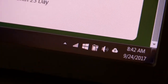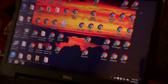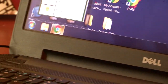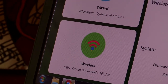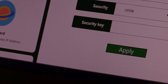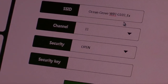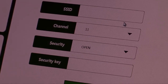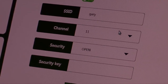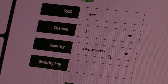Now if you want to have a password while you're in the campground, you can do this. Once you're connected to underscore EXT, you go back over to Google Chrome, open up Google Chrome and choose wireless at the bottom and select wireless. You see you have the underscore EXT. So I'm going to backspace that out, take it out altogether, and I'm going to put in Gary. That's going to be the name of my new hotspot. And under security, we're going to choose WPA security.